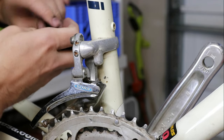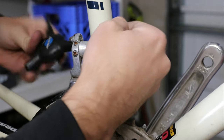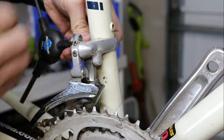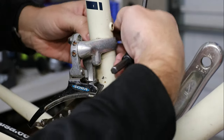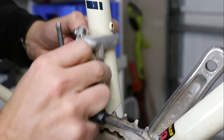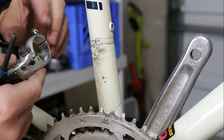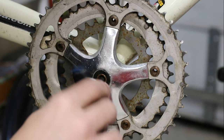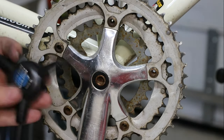Let's free the Sora front derailleur. That was pretty loose — interesting. These are a little bit particular because they have to be able to fit around your seat tube, and there are different sized seat tubes, so there are different size front derailleur clamps. I have used a spacer before and that worked pretty well. Now let's go ahead and get this big guy off — that's an eight millimeter and the AWS-1 only goes up to six.